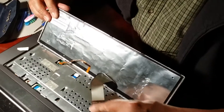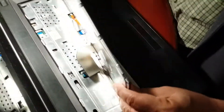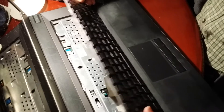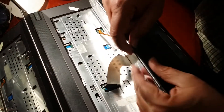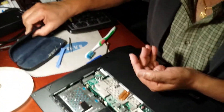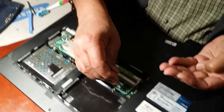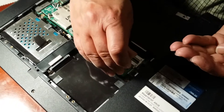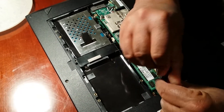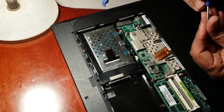My keyboard cable and mouse cable are now in place. The important thing I want to show you: there are six tabs that are going to go into these holes — you just slide it in like that. The tabs on top go in here. That's it — the keyboard is all set. Now back to the back side of the computer: there are three screws here from the motherboard that go on the other side of the keyboard, on the metal bracket. One here, one here, one here.